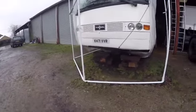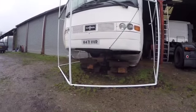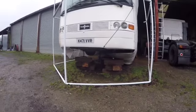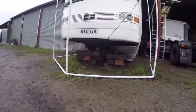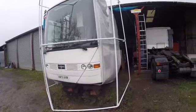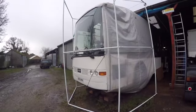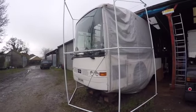We're lifted off the ground at the moment. One of the very first things we had added were hydraulic jacks — four 10-ton hydraulic jacks. We can lift ourselves off the ground normally. All those railway sleepers are there to help us because our barn has got quite a big sloping floor. Underneath you can see we've got some axle stands, so we're safely supported and level. The axle stands take six tonnes each — four of those is 24 tonnes, plus the four 10-ton hydraulic legs gives us approximately 64 tonnes of support.